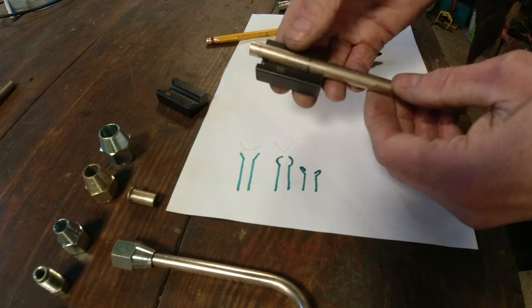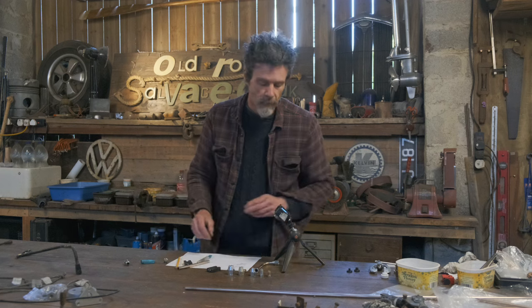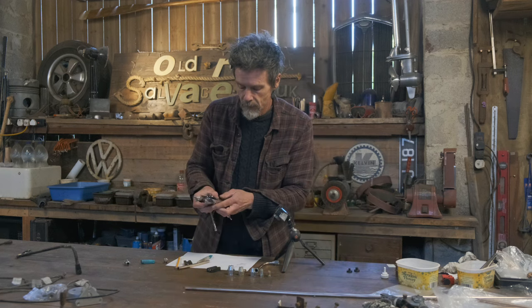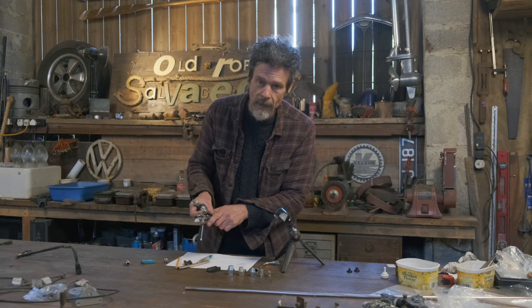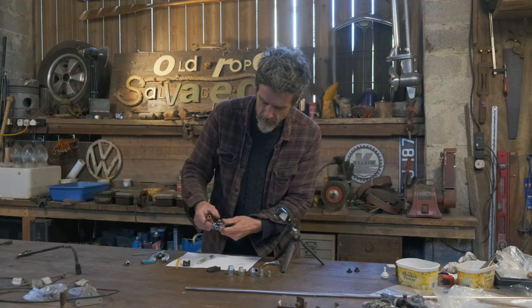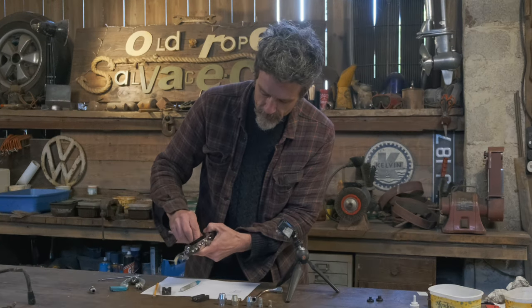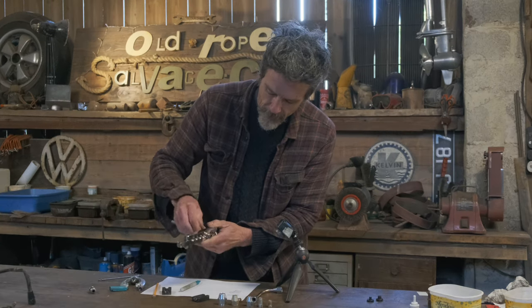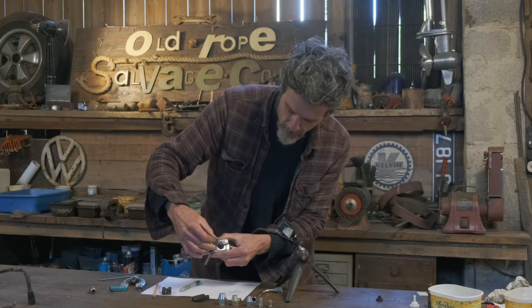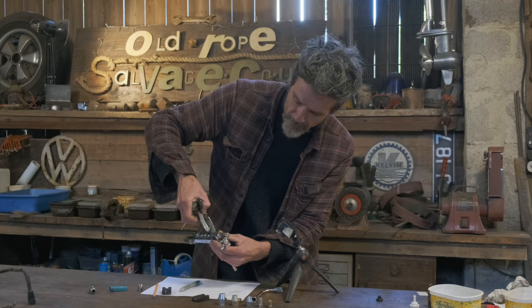Like I said, this is the die and the tool goes in. There's a couple of tools you can use for this. The simplest one is kits like this, and this is what I had to use for our bigger airlines. The pipe gets clamped into the relevant hole for it. You have to stick out a certain length at the end, 5 millimeters. The die for it gets put on the end, and that gets pushed in with this clamp.